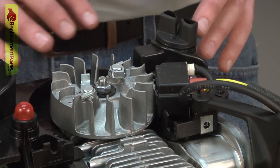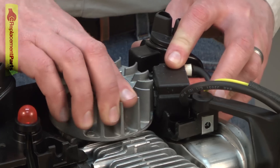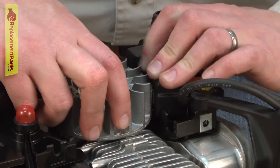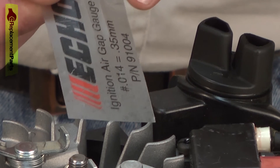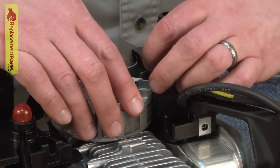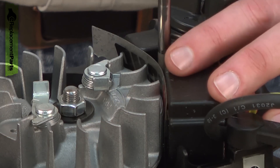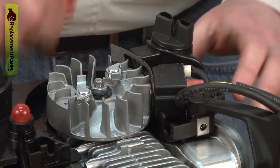Because of the way the engine is mounted to the frame, there's quite a bit of play and that can change the gap between the ignition coil and the flywheel. As you can see, the flywheel is now rubbing against the ignition coil, so I need to reset that gap. To do that, I'll loosen the screws on the ignition coil and pull the coil away from the flywheel — I'll move the magnets away from the coil temporarily. Now I'm going to use a gap gauge to set the proper gap: it should be 14 thousandths of an inch. If you don't have one, a good heavy business card will be about the same. I'll bring the magnet back around so the gapping tool is stuck between the ignition coil and the magnet on the flywheel, and I'll tighten the screws back down. Then remove the gapping tool.